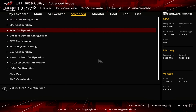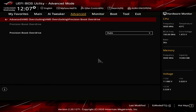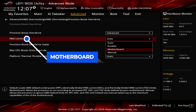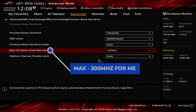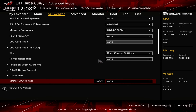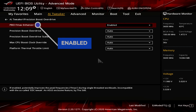OK, now we're going to go over to the Advanced tab. Scroll down to AMD Overclocking. Accept the terms and conditions and scroll down to Precision Boost Overdrive. Once we're here, we're going to set it to Advanced Mode. I recommend you set the Precision Boost Override limit to your motherboard specification. We're going to set Precision Boost Clock Override to 200 MHz. Now we're going to go back to the AI Tweaker tab. Scroll down to Precision Boost Overdrive.